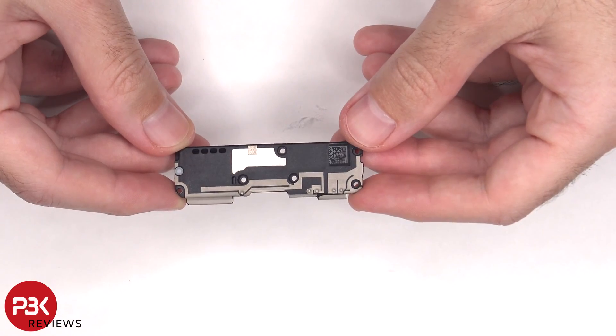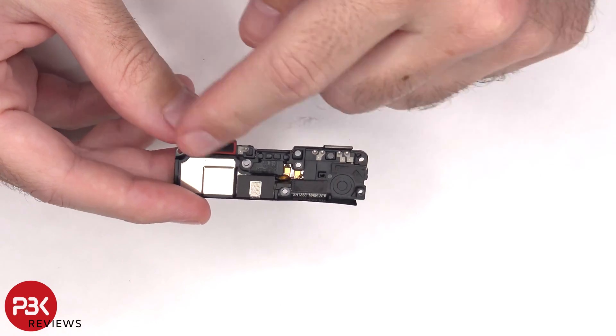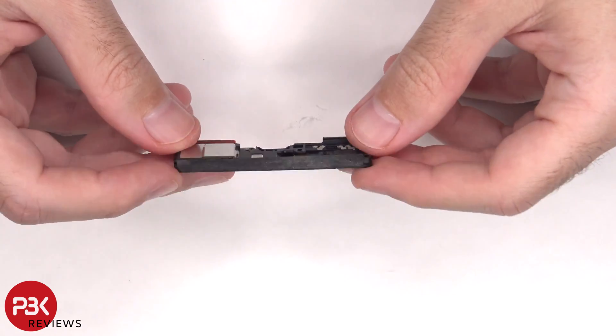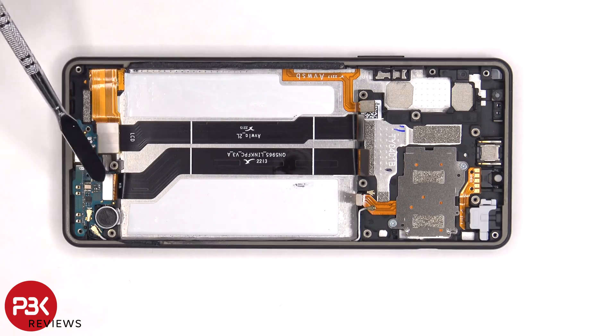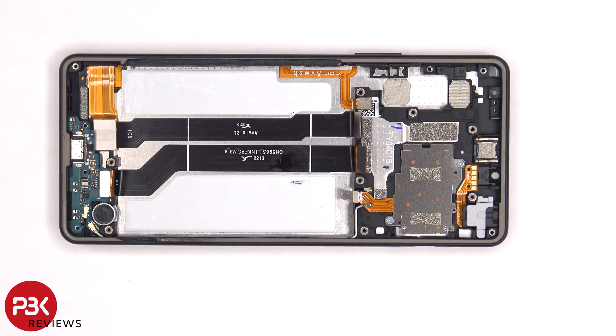There are more antenna lines drawn on the speaker assembly, and there's a rubber gasket and mesh filter over the opening. This flex cable connects the main board to the screen cable and this one connects the main board to the sub board. We'll need to start off by disconnecting this flex cable and the other ends of the coaxial cable from the sub board.